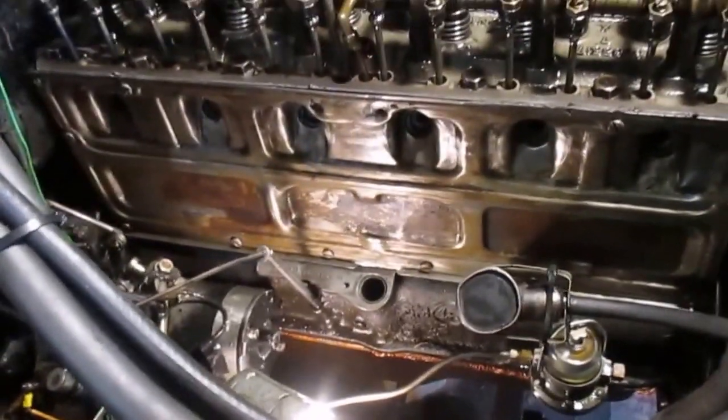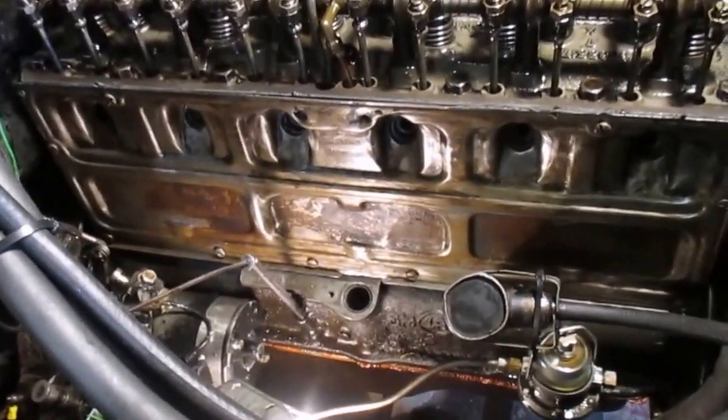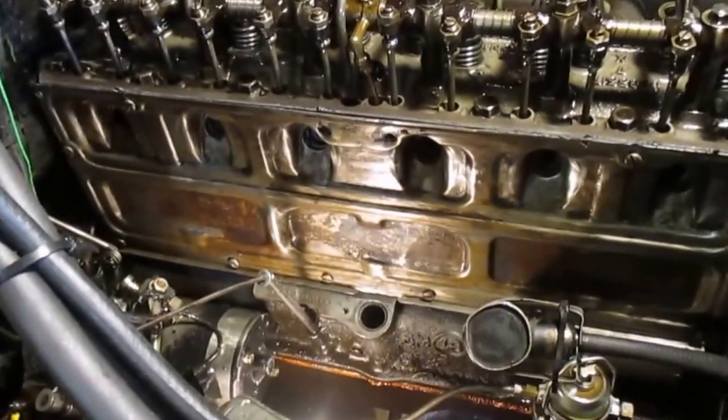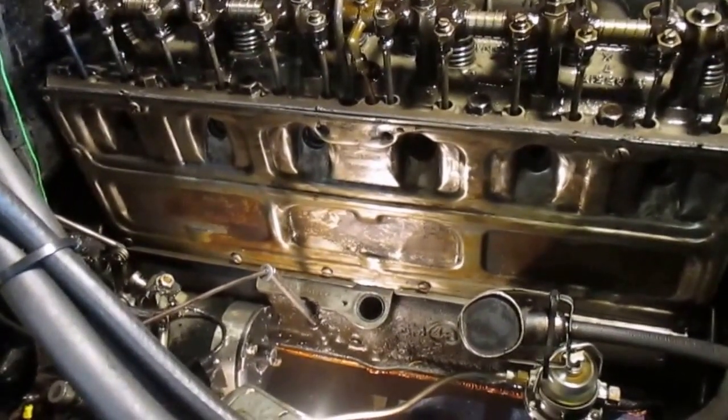And then once I got them as tight as I could by hand, I took a pair of channel locks, like so, and I fit them around the screwdriver like so, and I gave it a quarter turn. That's just enough to cinch it down, okay? Now there's enough of the gasket sealer on the threads of those stove bolts to act as a form of Loctite also.